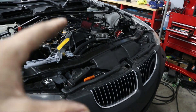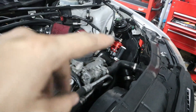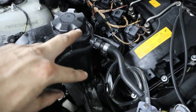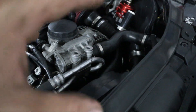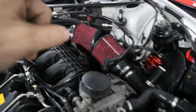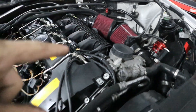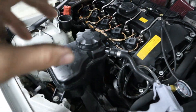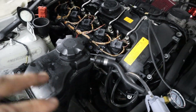So that leads me to relooking over the charge pressure system. I checked the tightness of the clamps on the charge pipe, as well as on the silicone of the outlets for the turbo on this side. Everything appears to be tight. The charge pipes down there for the intercooler have seals on them. But I decided that I wanted to look over the solenoids, because I know those can fail sometimes, and also the wastegate actuators on the turbos.